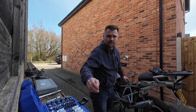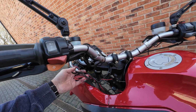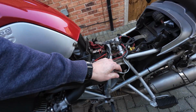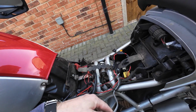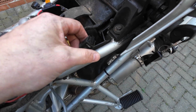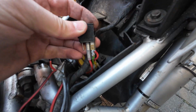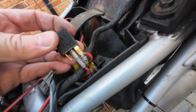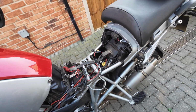You're not gonna believe that. Look at this. So that's the cable from the lights, a nest of them, and this is the plus, this is the minus, this is negative, and then positive goes to this relay, which I believe is for the extra horn, because there was, I don't know if it was a Sun Bomb, but look at this. This is how that's been connected. The extra horn doesn't work, probably because of that.